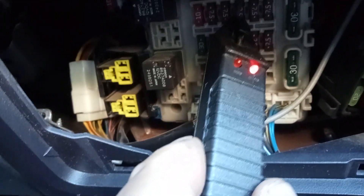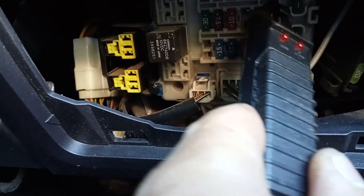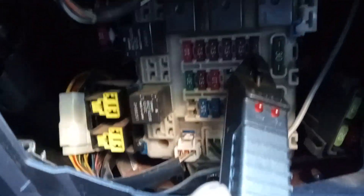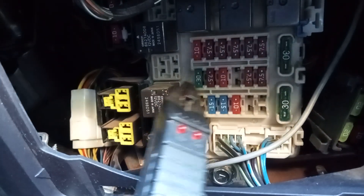Test all of them so you can see they all have a continuous circuit. It takes me five minutes to check every single fuse. Now you'll come across some — see this one? No light is on. I go to the other side and again no light is on. There's nothing wrong with that fuse because neither side is giving me current.